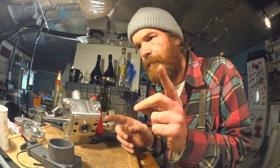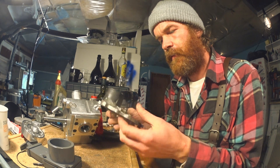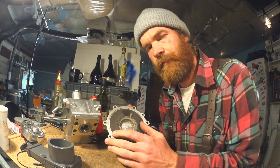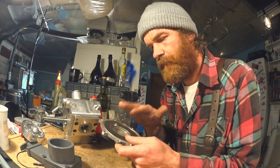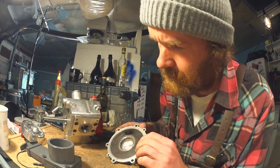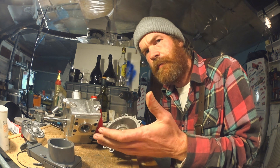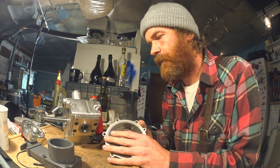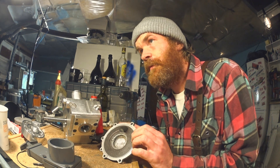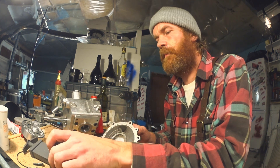It could use cork. Here's a Suzuki GP100 rotary valve cover and it is lined with a cork material — probably to seal better when there's excessive clearance. So maybe cork could be suitable for a slide valve if bare aluminium doesn't work. On a rotary valve it works fine with just bare aluminium. I've been running the SPX engine and that's just bare aluminium — there's about 0.2mm clearance for the valve. So probably it won't be a problem.